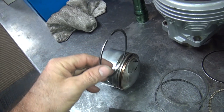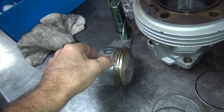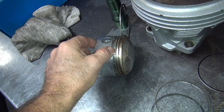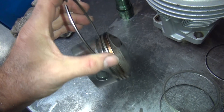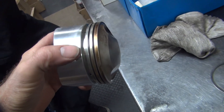So how are we gonna fix this quickly? I had my fingernail file out and I was filing on it a little bit. Do not file on the bottom groove - file on top of the groove, because the ring seals on the bottom. It needs to be a smooth finish. The top of the ring doesn't matter, or the top of the groove. So his piston needs to be opened up - appears to be a little snug right there. Wire wheel.